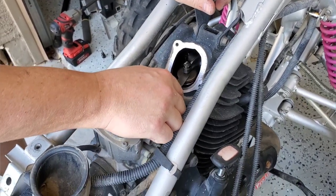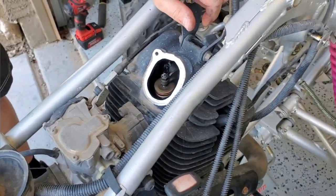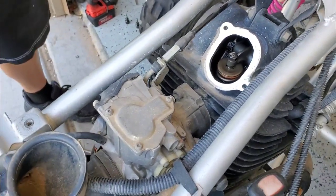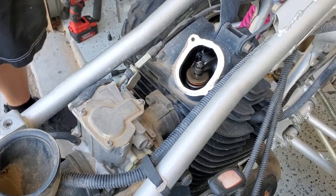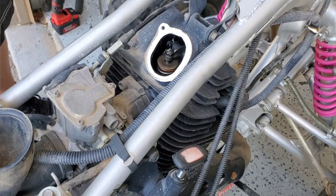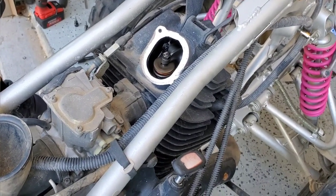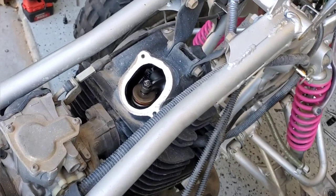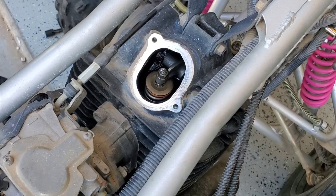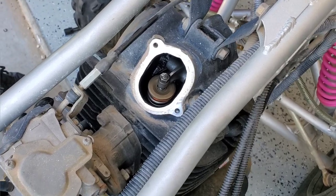There's a little bit of tug to the feeler gauge — we are spot on. Intake valve clearance is now good. I'll do the same thing on the exhaust side, going between 0.16 and 0.20mm, and that's it. Valve clearance is set and I think we're done for the day. We did a lot on this warrior — appreciate you guys watching. If you like these videos please subscribe.